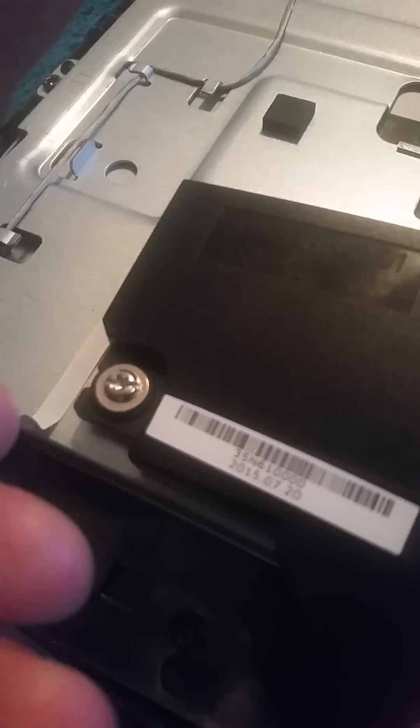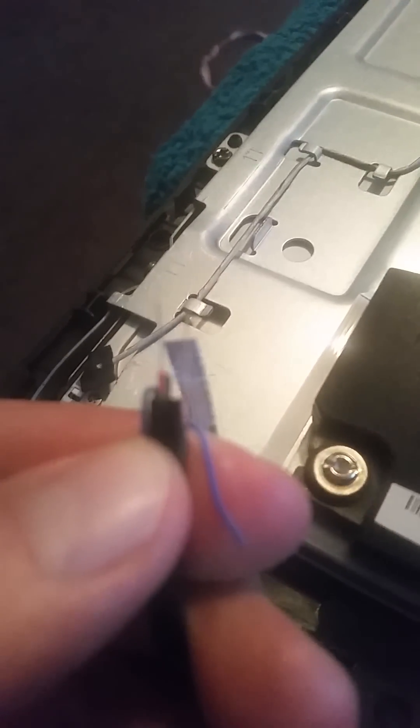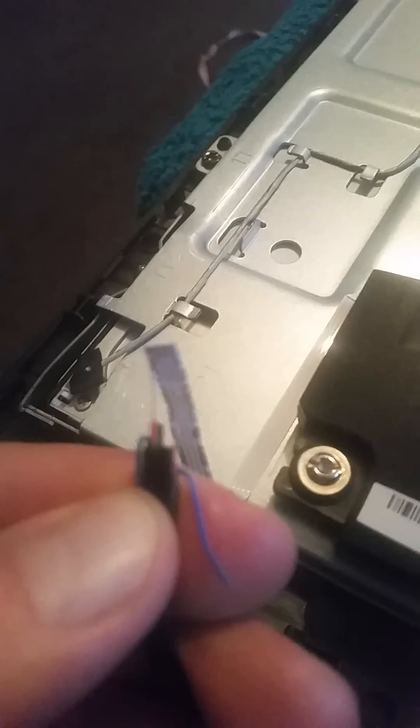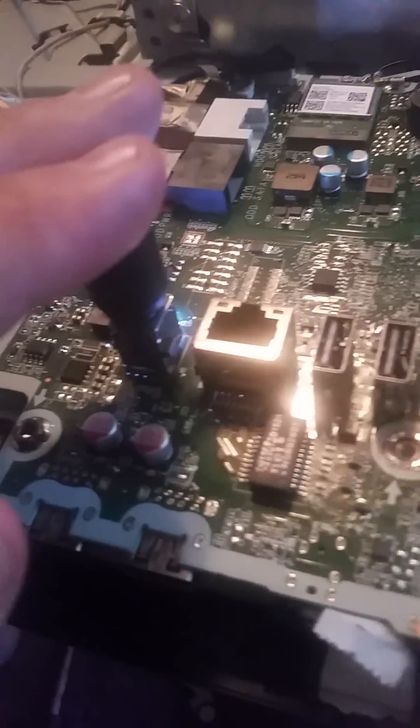You can do it by touching the ends of the ribbon or by touching the pins themselves — you want that second pin and that fourth pin. Once you get it right, you're going to see a light come on over here. It may not boot up at first — you may get a light, some noise, and error beeping. That's fine. Simply unplug this, wait about five seconds, plug it back in, and make your attempt again. Eventually it's going to boot up.